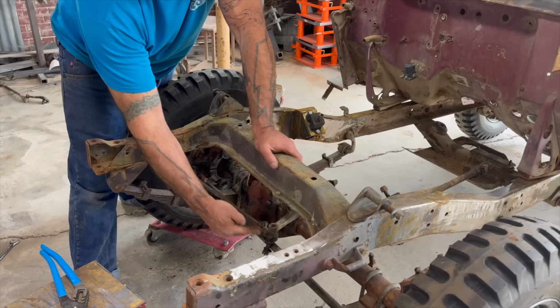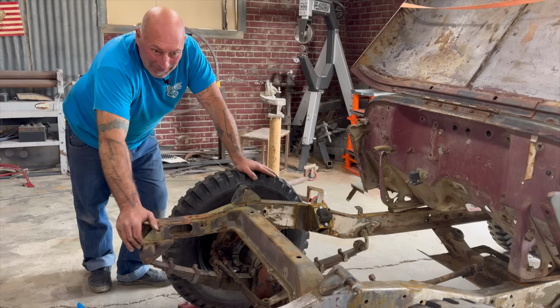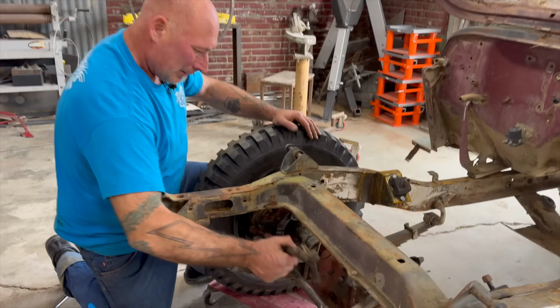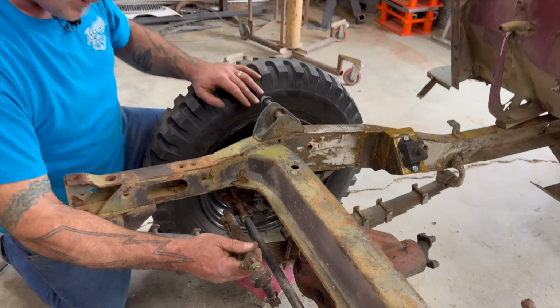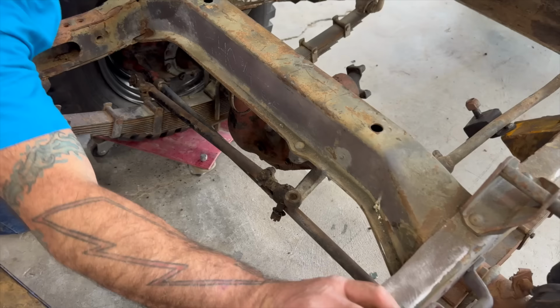So this has got to come all the way over to here. Set that box in place. I know we didn't get much done yet, but I'll tell you what we're going to do. We're going to make the template for that steering box. Because no matter what happens here, this tie rod is going to be here. If we get a different end that maybe has a knuckle up above, or we flip it, I don't know, but we can definitely put the box in because we have a reference of straight across to these steering points. So let's just carry on as if this is the proper end.